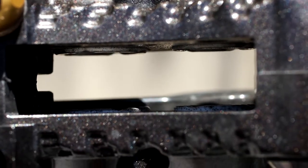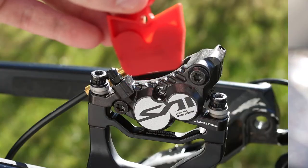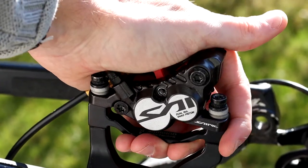Now clean the pistons with a towel that I personally forgot, and then push with a tire lever all the four pistons inside the caliper. Now take a blocker of medium size from your bleeding kit and lock it inside the caliper with the screw of the braking pads.